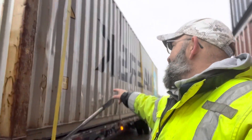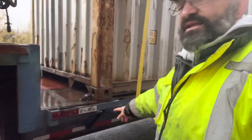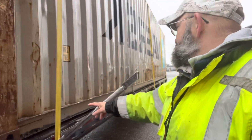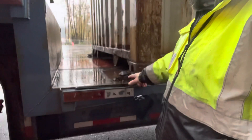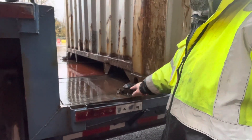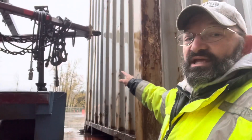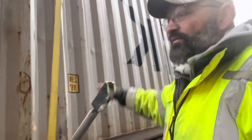This high cube container is nine feet six inches tall, as you can see right here. It's sitting on a flatbed step deck. The upper deck is about 11 feet, but the lower section is 42 feet. This is a 40-foot container, so I've got a little extra space. The problem is I wanted to connect this container to the container bolts — also called container rivets, container bars, or container load brackets — which slip into these holes and lock the container. However, because I've got a dolly sitting up there extending a little bit, I cannot make that connection, so I've got to leave it where it's at.